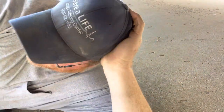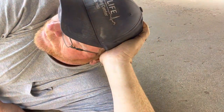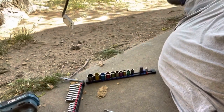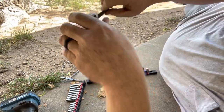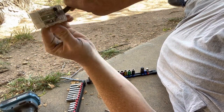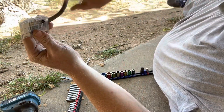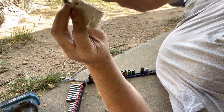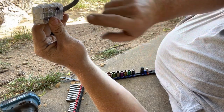Welcome back YouTube, this is the third and final video on this floor replacement on the camper. We've got the positive and 110 line going inside the camper already out. Instead of putting it back using the little tabs, I'm going to wire nut them together on the inside so I know they're secure, they're not going to come apart, and they're going to make good contact.